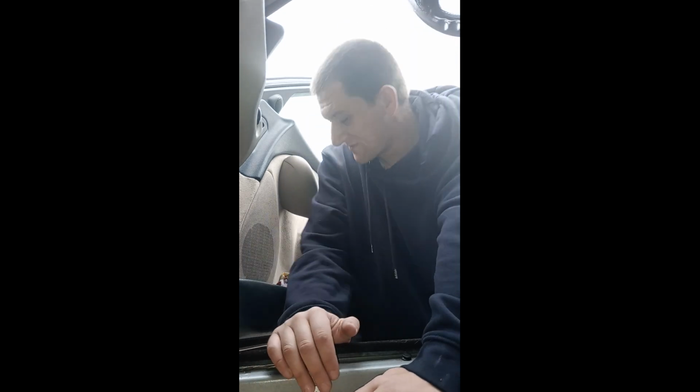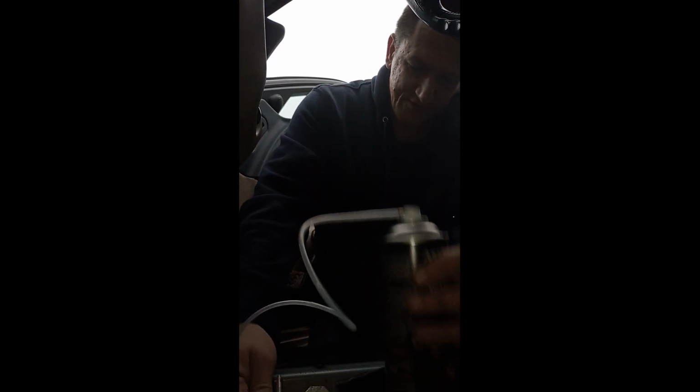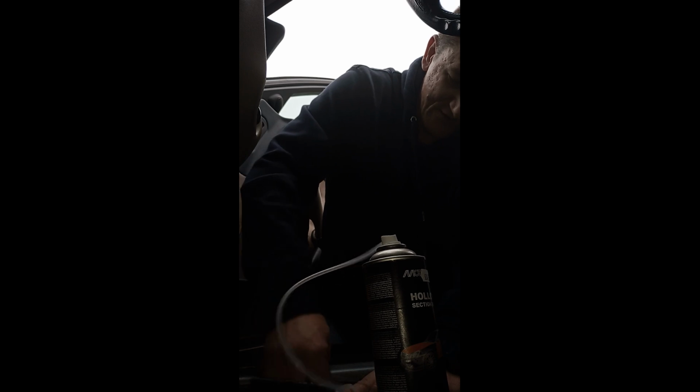There's the screwdriver. Right. So, what I'm going to do is just put a small hole into there. You can take them off. These, they don't really do much, to be fair. They were just covered up at the factory. Make a small hole. It's quite easy. Then all we do is go sticking the wand in as far as you possibly can. Feed it right the way in.